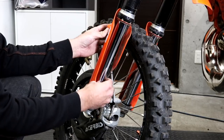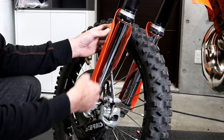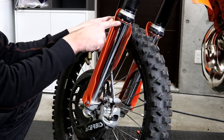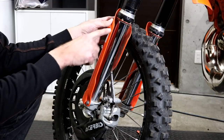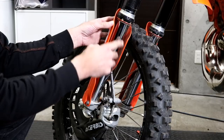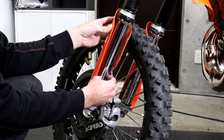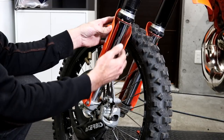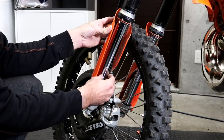If the tube is covered in dirt it's best just to rinse it off. If you're using a power washer you should be careful that you don't point it at the seal or it can force water and mud up underneath the seal. If you've got a lot of dirt on the tube itself, just rinse it off with water and then maybe use a sponge with some soapy water.